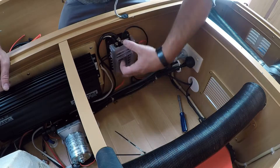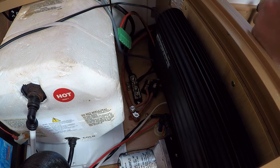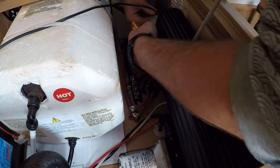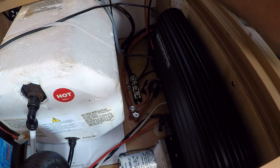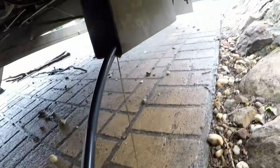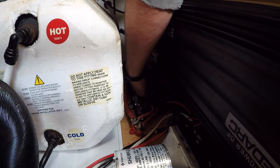Let's get that in there and sorted. Now I'm just hooking up the Redarc unit — going from the bus bar. The thing I like about the Redarc is this connector: I've got it sitting in there loosely, make all my terminations, and then the final last thing will be to just click it in. Nice and big connections handling the 6 gauge cable. I've also got to get cables from the drawbar so the car can get DC into the Redarc unit on 6 gauge, and I'll run the same for the solar because it's just going to an Anderson plug tucked outside onto the chassis. To protect it and keep the water out, I'm running it through a cable gland and filling it with silicone on the outside.